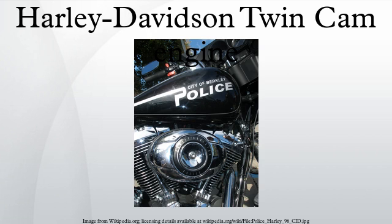The Harley-Davidson twin-cam engines are motorcycle engines made by Harley-Davidson since 1998. Although these engines differed significantly from the Evolution engine, which in turn was derived from the series of single-camshaft overhead valve motors first released in 1936, they share a number of characteristics with nearly all previous Harley-Davidson engines. Both engines have two cylinders in a V-twin configuration at 45 degrees, are air-cooled, and activate valves with push rods.